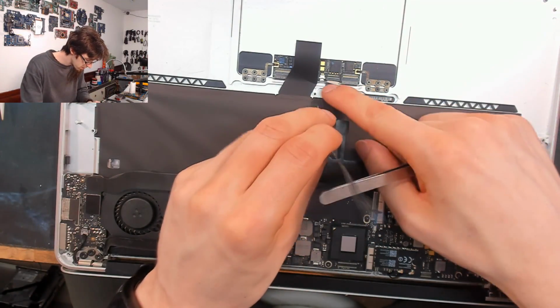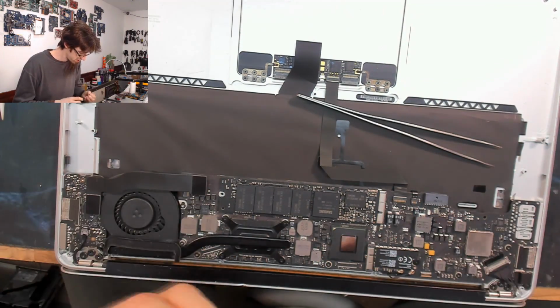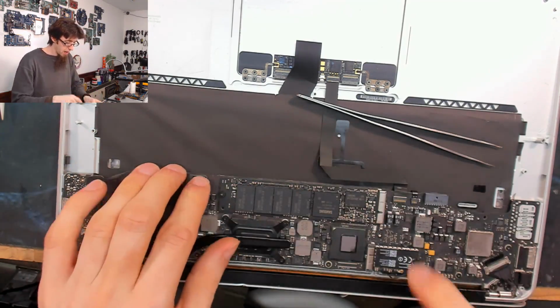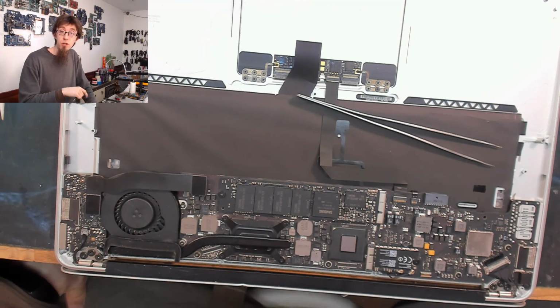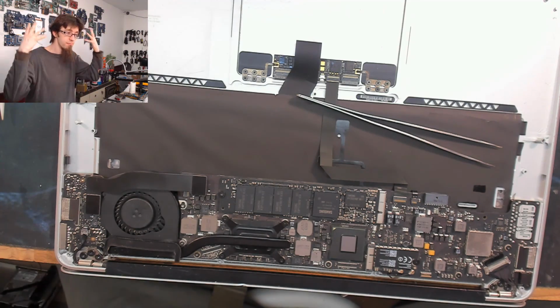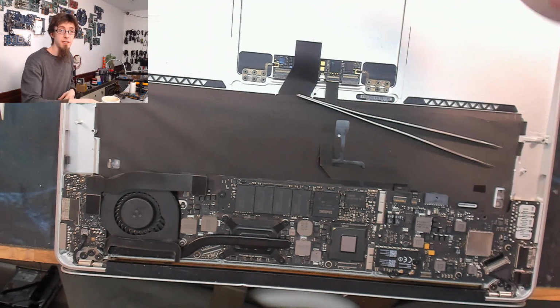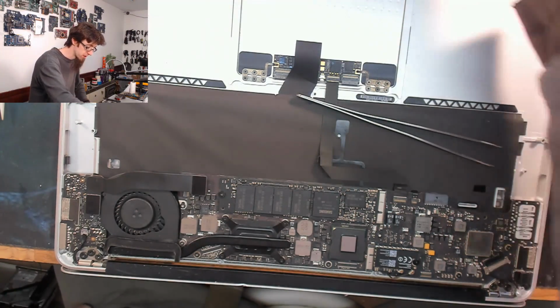Adam. I saw a MacBook Air the other day that had an adapter from the Apple SSD connector to an M.2 connector, and it worked just fine with just a regular M.2 SSD in it. Couldn't believe it. Years I've just been buying secondhand Apple SSDs. You can just use ordinary M.2 SSDs in the newer ones with M.2 adapters. I always thought those were cobblers.